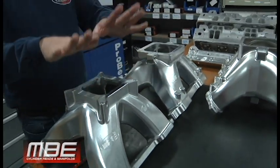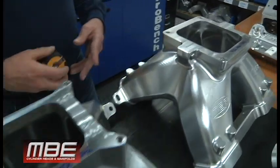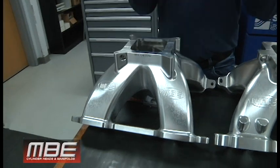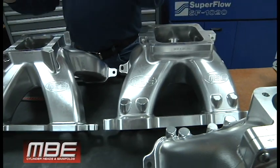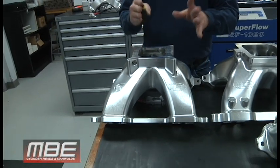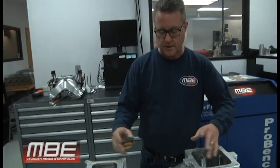I want to show the difference between an endurance application and the drag race application, and some of them are obvious — you've got a 4500 and a 4150 carb flange. But here's the key thing: this manifold has to run from 3,400 RPM all the way up to 8,500. The 3,400 part is the challenging part. No road race guy wants to get passed coming out of a corner, and no super late model guy wants to get passed on a restart. So we have to make things small so it will have throttle response at 3,400 RPM on restarts but still run up top.